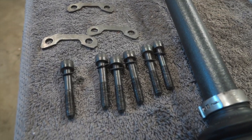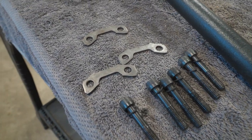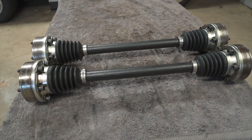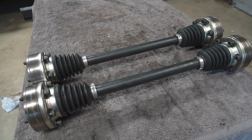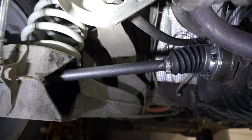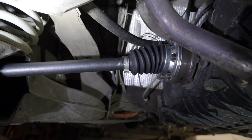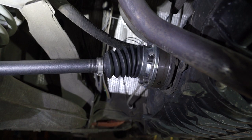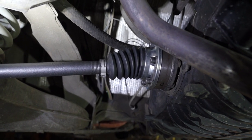Our bolts are cleaned up. Each bolt has a serrated washer on it — make sure those are on there. All our pieces are ready to be put back on. Two fully rebuilt CV joints — look how nice those look, almost too pretty to put on the van. All done and installed. I'm hoping we get more miles out of these boots, though I'm not as confident as when I first put them on — the bellows are touching each other, and we do have about an inch or so of lift which probably isn't helping. We'll see how they hold up compared to the Rockfords. Not a really hard project, but super messy. We needed to get this done — that boot was torn and just going to get worse. We've got big trips coming up in 2022, so if you have any questions or comments, drop them down below. Thanks a lot.